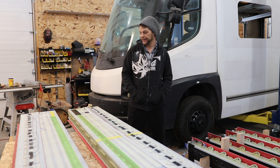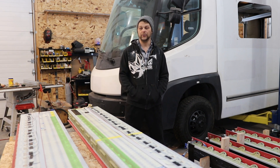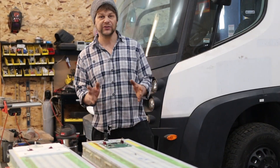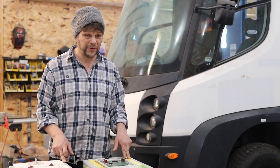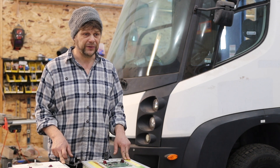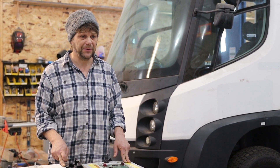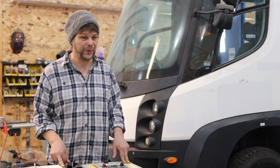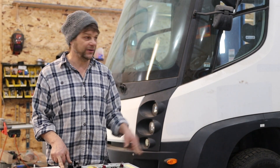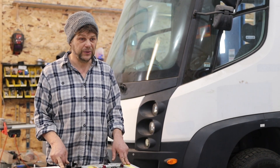There are cells revealed from each pack, which was convenient for us — spot welded, and that nickel strip soldered to the wire. That gave us the ability to come out the end with the wires that will be connecting to our Dilithium BMS. Here are our last two modules. These things are at least 200 pounds and it's quite a job for two persons. You're carrying around a battery that you just really don't want to drop, so that adds a little bit of stress — it's quite a deal shuffling all these modules around.